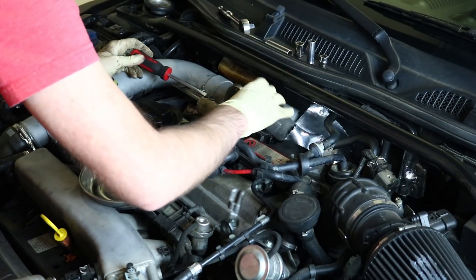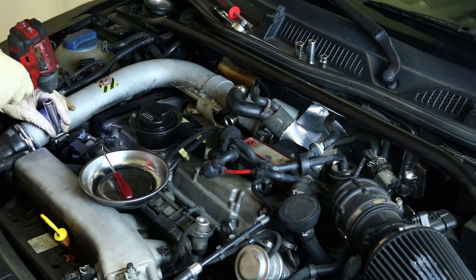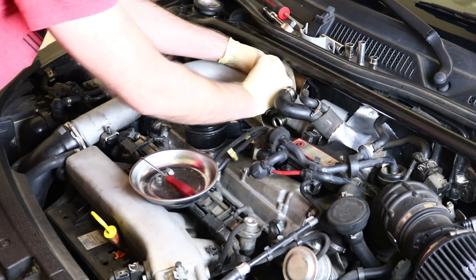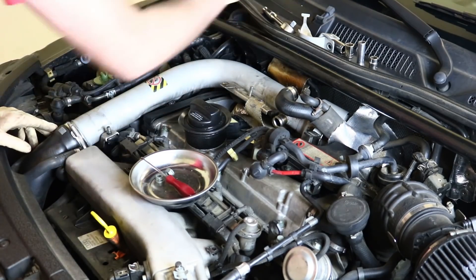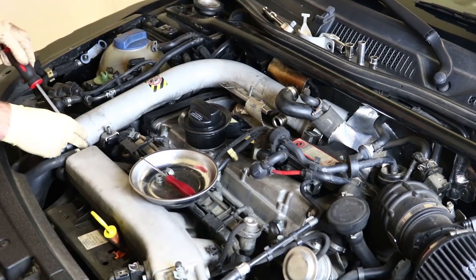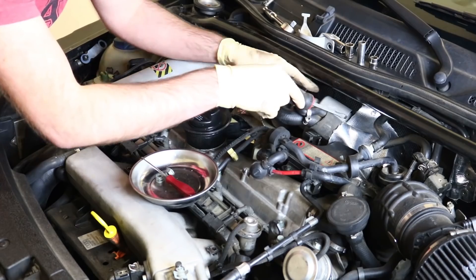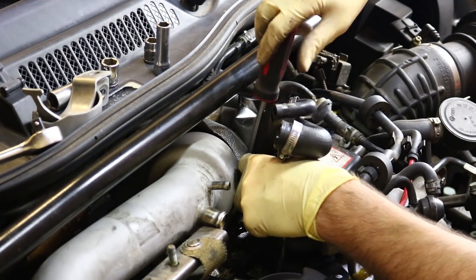We can pop these up and out of the way, and then we have these 13mm bolts that mount this pipe on. These clamps kind of just hook on and then over. Take that one off, take this one off — you don't want them to fall down. Then we should be able to take off this hose here and try to get this pipe out of the way completely. I'm going to take this hose clamp out of the way just so that we don't knock it down into the engine bay. I'll loosen this last clamp more than I think I necessarily should, just to make sure we don't struggle with it.